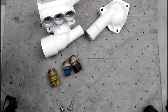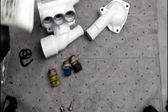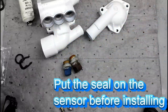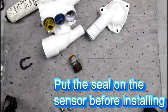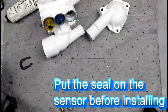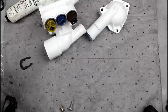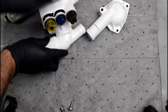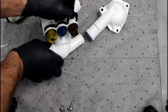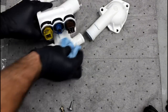I'm not worried about those clamps because we have all new clamps and seals in the bag. The sensors may stick a little bit — just work them and they should eventually come out. We'll set that flange aside, get our new flange, open up the seal bag, put some dielectric silicone on the seals for the coolant temp sensors, and install them in the location they came out of. If we don't have the orientation quite right, that's okay — we can rotate it once it's installed to avoid any stress on the harness.